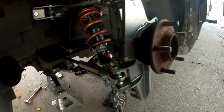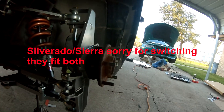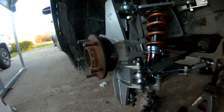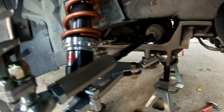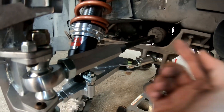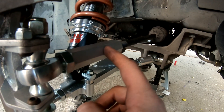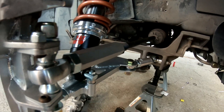I got the Silverado tie rod installed on the other side. I have the steering wheel straight, so on this side with the Silverado tie rod I'm at pretty much zero toe in. I have the heim screwed all the way in and the tie rod screwed as far as it will go inside of the tie rod adjuster. It looks like I'm just going to cut about a half inch off of this tie rod and we'll be all set.